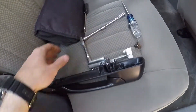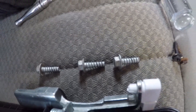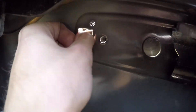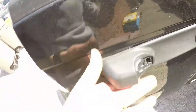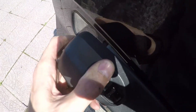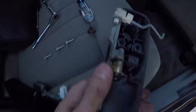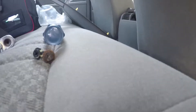Total three screws — let's remove them all. I got the three screws out and now the handle should be able to come out. Press here, and now look — you see the green pin. We have to remove this green pin, so just press on it, take it off, pull it out, and now we're able to get the handle out. Slide it out — it's out! It wasn't that bad. Now get the link out from here.